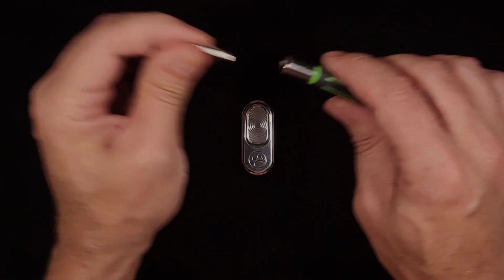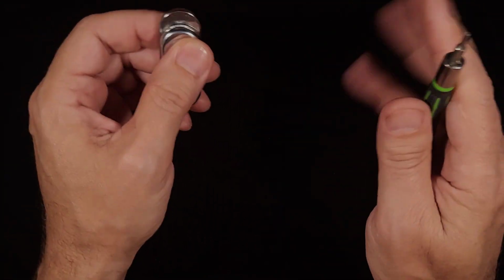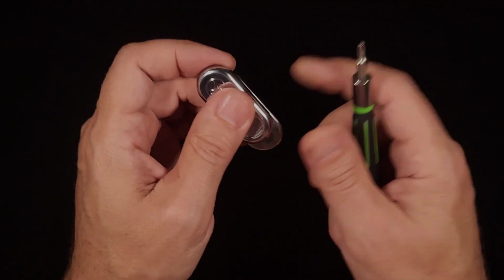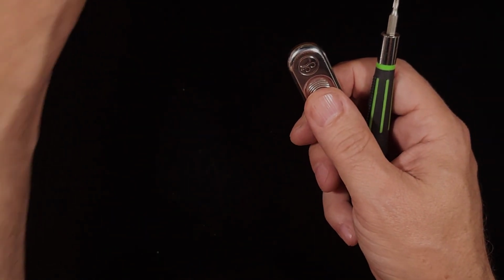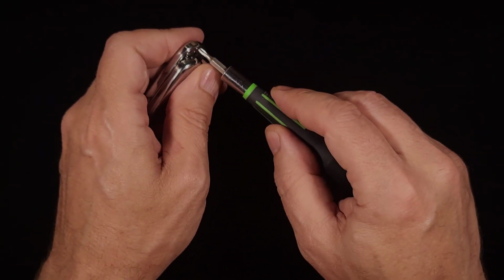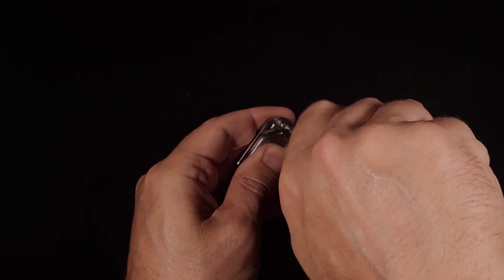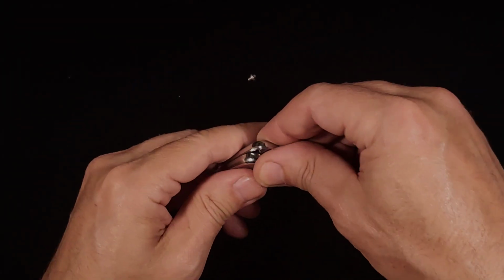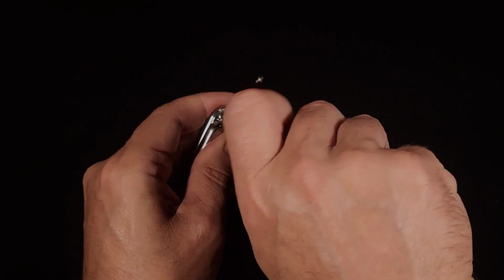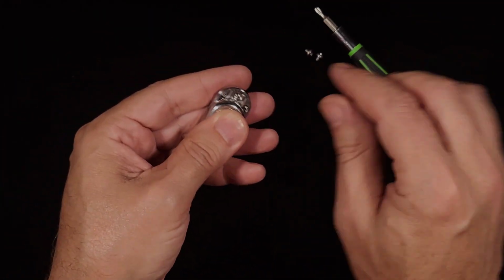To take it apart, you'll need a Torx T8, I believe. Could be a T7 or T9. I think T8 is right. Mine's a little bit worn down. I sort of stripped it. That's one of the reasons this is still together. I had trouble getting it apart. But what you need to do is remove these 2 screws first. And you don't have to worry about everything flying across the room with this one. The springs are not under that much tension.